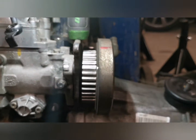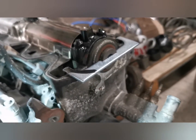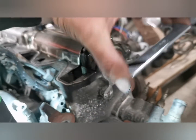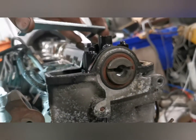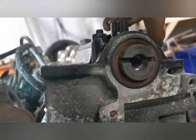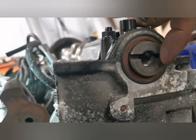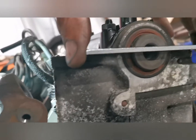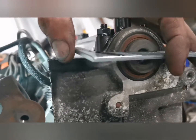If it was set and running sweet you're going to be happy. Just in case you want to make sure the cam is set absolutely spot on, pull the cam pulley off and in the kit you'll get a flat plate — it's off-centre, so if it's down at the bottom and it won't go straight into the head, you know you're 180 degrees out on the cam.